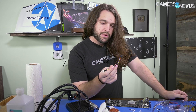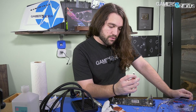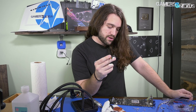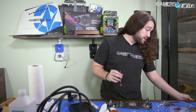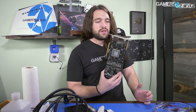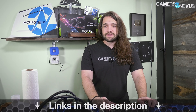These cables I bought from China — they're four-pin PWM to a four-pin GPU fan cable, so that connects with your pump and video card fans and then you can connect it into the motherboard if you wanted to slow down the pump speed and make it quieter. We used that to test that the pump works, and it does. Basically, not sure why it's having issues — the card still boots, it's just having temperature problems. I'll look into it more and maybe do another video if we can fix the problem. For now, it's haunted with some kind of thermal ghost. Thanks for watching — subscribe for more, or visit patreon.com/gamersnexus or store.gamersnexus.net.